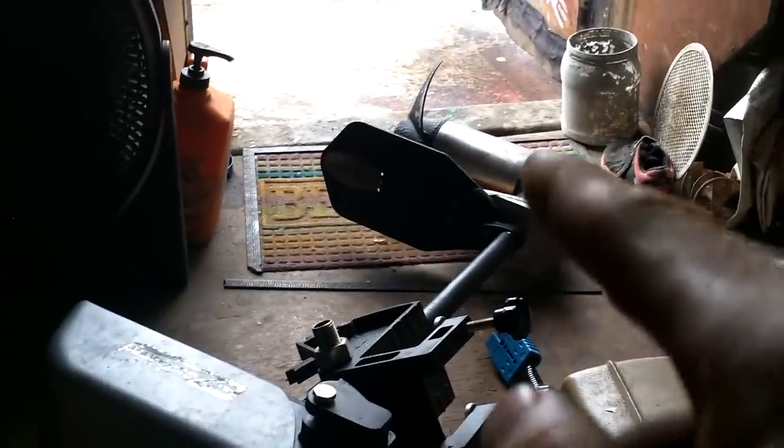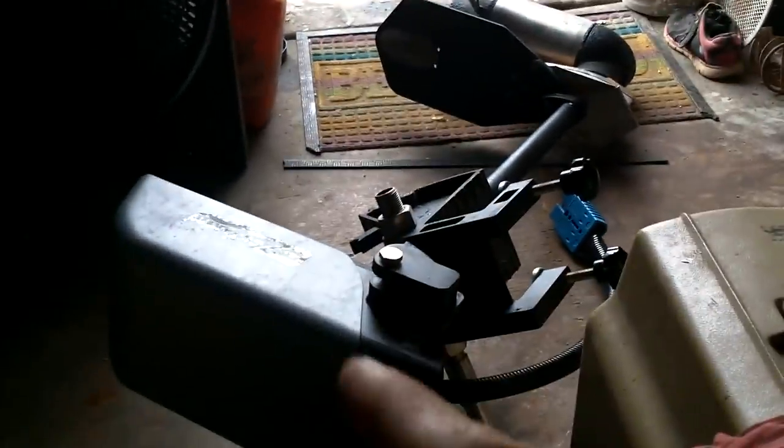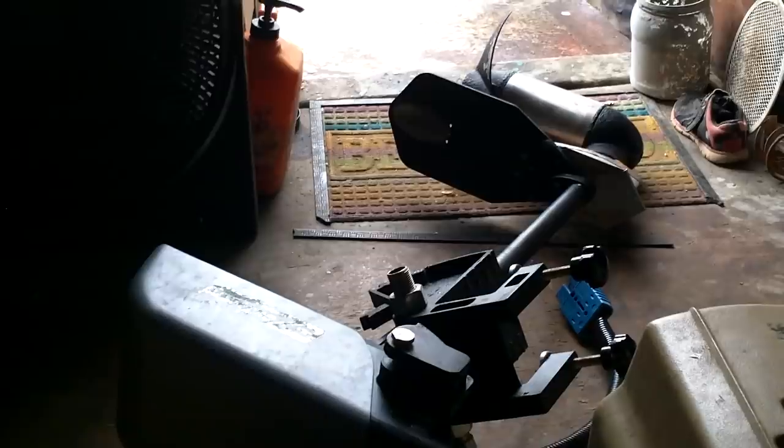All right, no more brushless motors, because when the electronics go, you can't replace it. And a motor with brushes doesn't need any electronics to run it, and the brushes are easy to replace. So I just need to make sure I have extra brushes. Not a big deal. They last a long time.